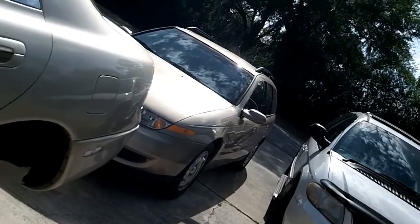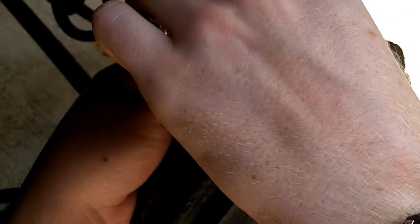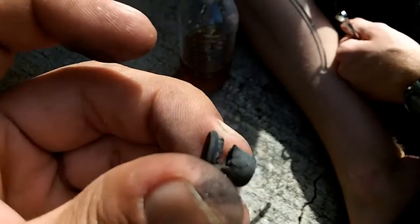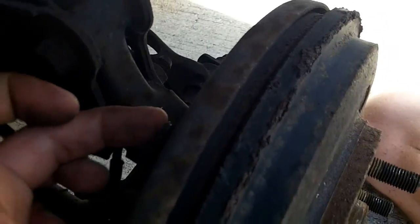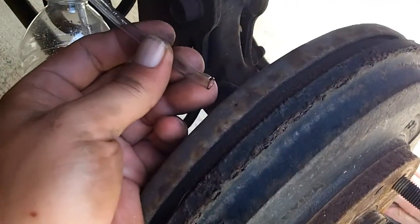This is a good way to show everyone - I'm going to show Caleb how to do it, and if I can show him I can show you too. First thing you're going to do is put your wrench onto the nipple. There might be a cap on here - yeah, the caps on this one are all messed up. It is good to have caps on your bleeder valves so that rocks coming up don't hit it. On the rear, the bleeder valve is right there. Now set your bottle up like that - that works beautifully.